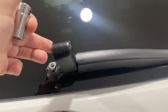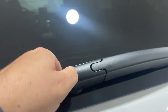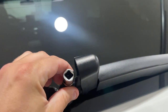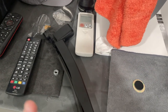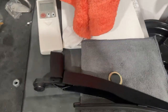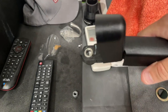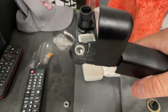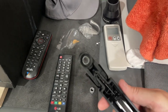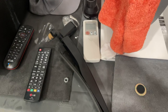I'm going to go ahead and try it out since it's kind of reversible. First things first, you just lift up on this — sometimes it's really snapped down hard and you have to pop it. This is a 13 millimeter bolt. I've already had this arm off once before because I put CarPro Deluxe ceramic coating on all this plastic. Once you take the bolt out, grab onto this end and use the wiper arm to rock it back and forth gently while pulling up — it'll eventually loosen up and come off. It's a tapered fit with splines, so just be gentle and it'll come off in one piece.